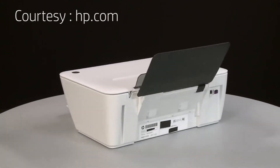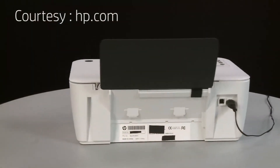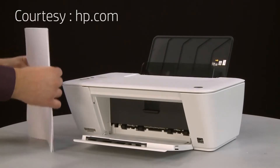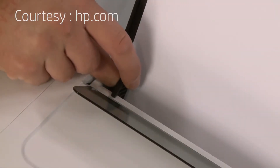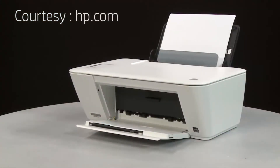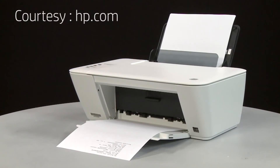Turn to the back and reconnect the power cord. Return to the front. If the printer does not automatically turn on, press the power button to turn it on. Align a stack of paper by tapping it on a flat surface. Load paper into the input tray until it stops. Slide the paper width guide inward until it stops at the edge of the paper. Do not push the guide so tightly that it starts to bend the paper. On the printer's control panel, press and hold the Start Copy Black button and the Start Copy Color button at the same time. The test page prints. If the page prints successfully, the issue is resolved. If you're using a USB cable, reconnect it and resume printing as normal. If the page does not print, go on to the next step.